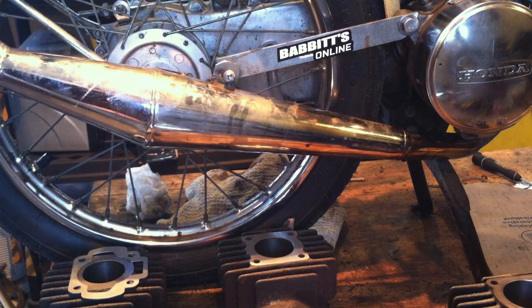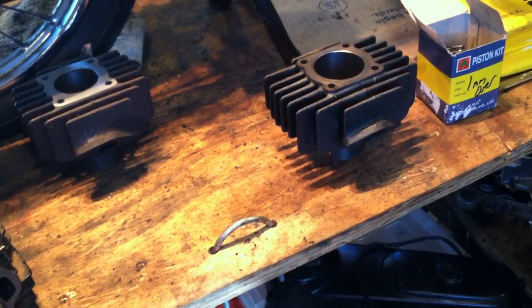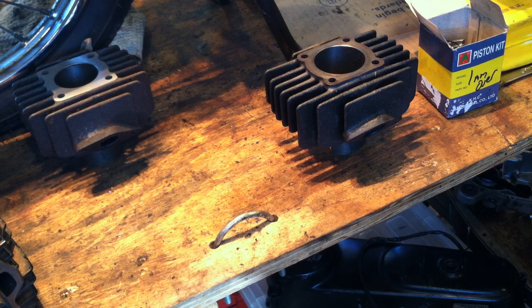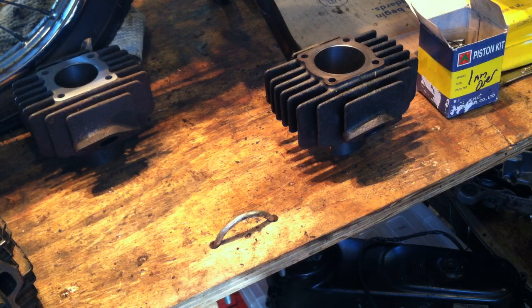You may not be able to reach 8,500 to 9,000 RPM with a stock cylinder — we'll find out. I didn't raise it that high anyway. These Yamaha cylinders are destined for the black QT, maybe one of my townies. I'm also building another engine with the YT60 cylinder and that Puch cylinder head, which has the same mounting distance between the studs — it makes you wonder what the stroke is on those Puch kits.